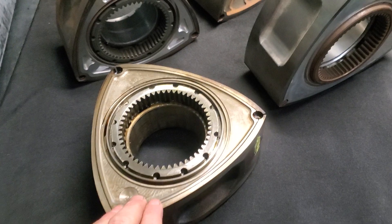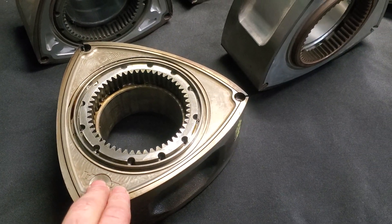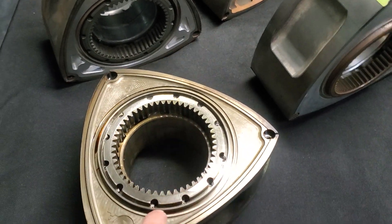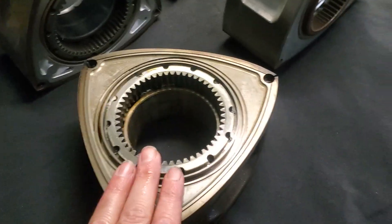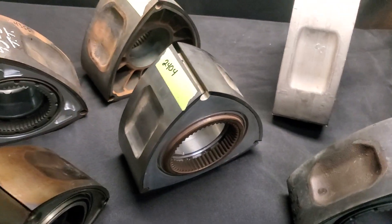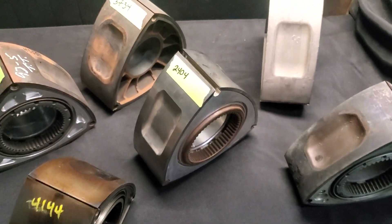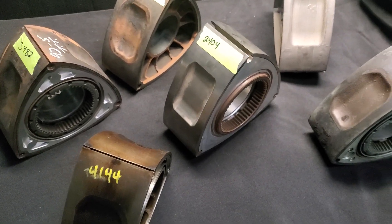Obviously, this is the traditional lightening that's been done for 20 to 30 years on rotors. Some places like Racing Beat actually go in and do internal lightening; at MazdaTrix we just do the face-cutting — it's very reliable, very easy, very cost-effective. But ten years ago we were dreaming of an aftermarket rotor. I hope this helps continue to paint the picture of what MazdaTrix had going on. Thank you, MazdaTrix. Thanks for watching KMR.